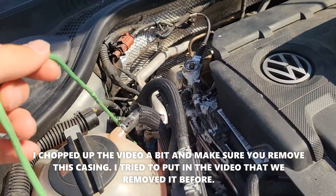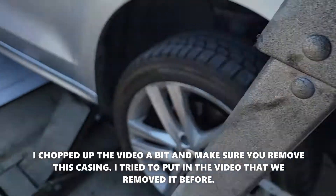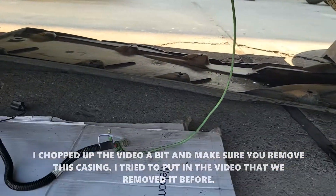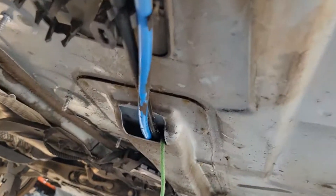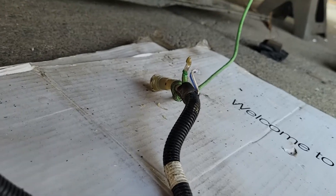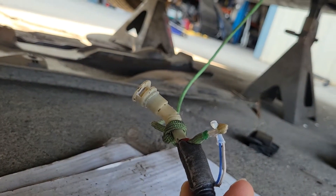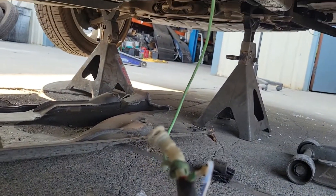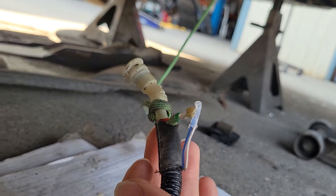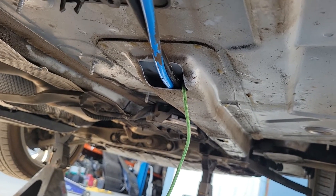What we did is we attached the string. We opened up this plastic casing as much as we can, and on the bottom we took the splash shield off. This is the hole that the rail has to go through. We weren't able to find any information on how to pull this through the way the dealer does it — nobody talks about it, top secret. So what we did is we attached this piece of rope and pulled it out towards the back of the car. Now we're going to attach the string to the new one and hopefully pull it through all the way to the front, so it stays the way the factory intended.